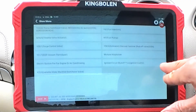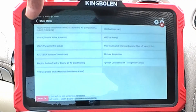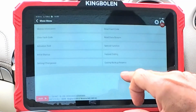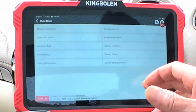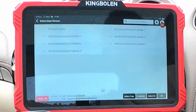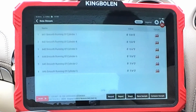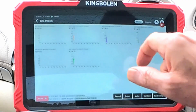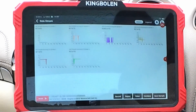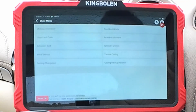There's a purge control valve, air pump switch valve, throttle valve actuator - it's got a lot of things you can do, but nothing related to the sensors directly. You've also got variant coding, coding backup, and reserve. In the read data stream you can actually look at all the live information - smooth engine running. Let's go into that one and look at cylinders one, two, and three plotted on a graph - you can see if they're all working in unison.